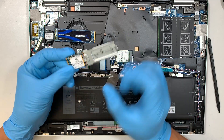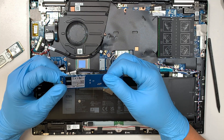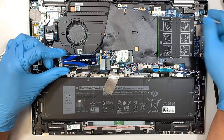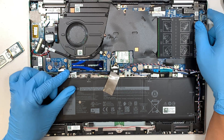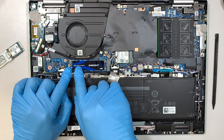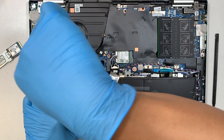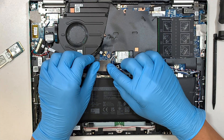You can buy the same mini-version SSD, but if you purchased the full-size M.2, all you have to do is slide it back in. Make sure the gap matches at the bottom, insert it at a 45-degree angle, slide it to the right, push it all the way in, and then rest the M.2 drive on top of the screw bracket. Don't forget to put the screw back on to secure the hard drive.